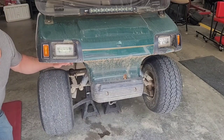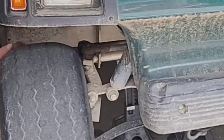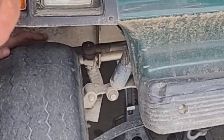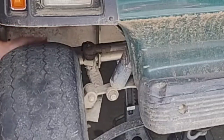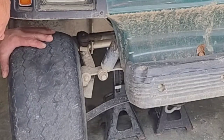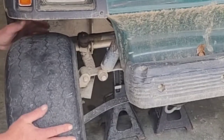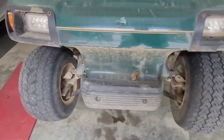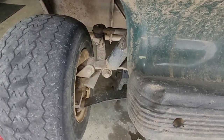With Walter up in the air, I'll zoom in here on the camera, but you can see the tie rods. They're all worn out, and then the kingpin and the kingpin bushings are all worn out. Upper control arm bushings too. So we're going to pull the wheels off and start tearing into this.